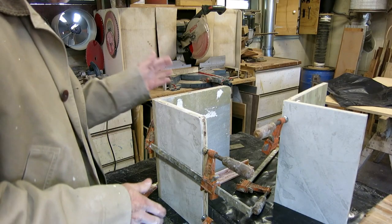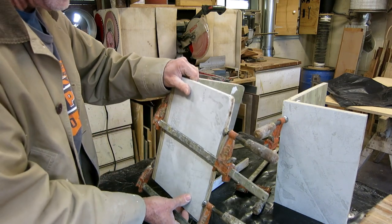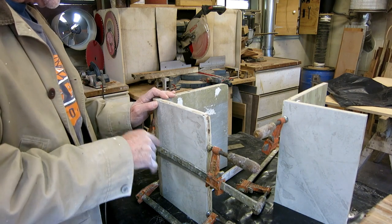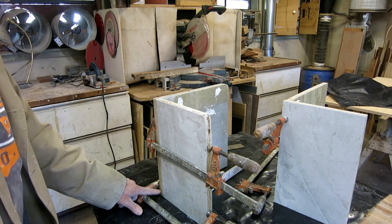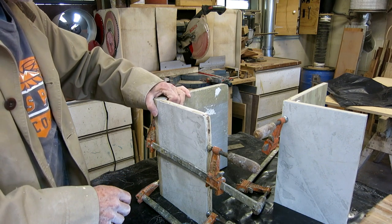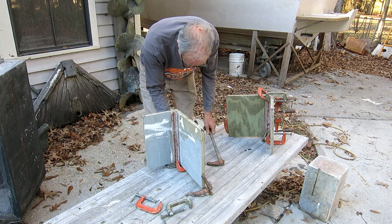I've cut out the front and the top for the back step seats from the treated plywood that was under the console. I've got enough material to do these. I'm going to epoxy this joint and then I've cut some angles from the old boat and I'm going to epoxy them on the inside, because this needs to be really, really strong. Next day we pull the clamps off and they look good — they look strong so far. Everything's lovely.